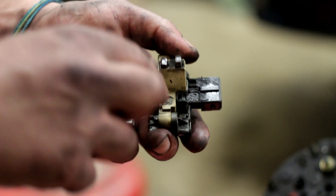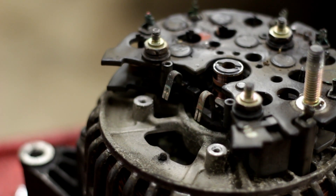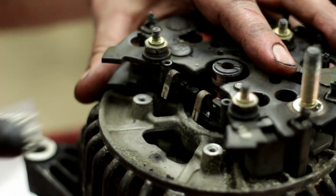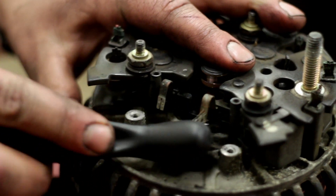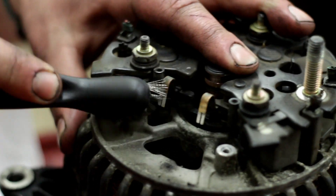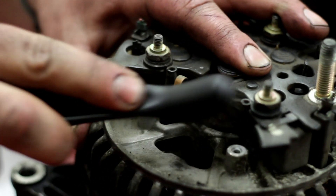There are contacts that contact this part and this part, and they're pretty dirty. I'm hoping that between those two things, this new voltage regulator will make the difference. Using some electrical cleaner, we're going to clean these contacts. I'm just going to spray them a little bit. If you want, you can use a wire brush, but you've got to use a soft one — if you use a really coarse one it'll scratch them and won't make as good a contact. There you go, good as new.